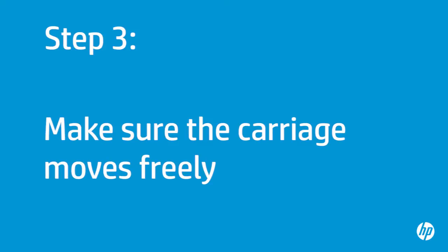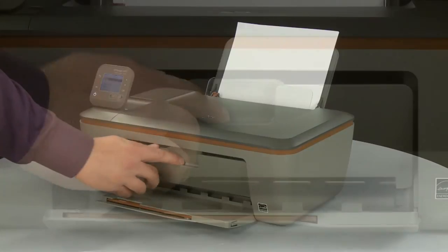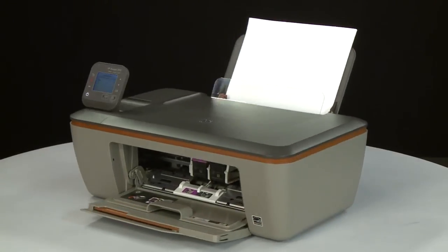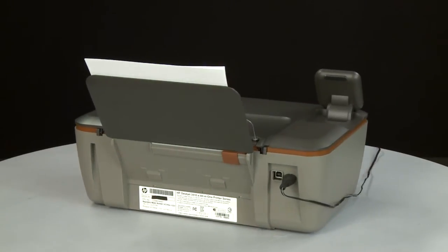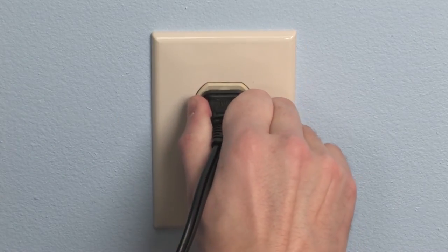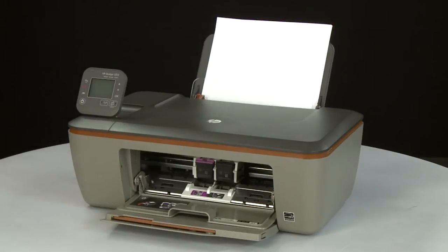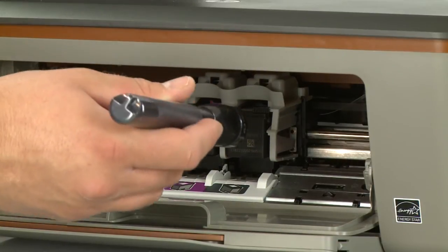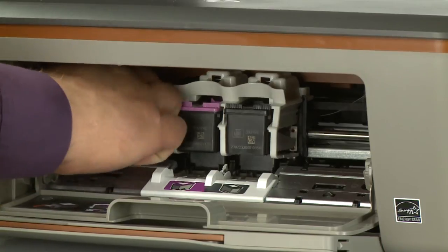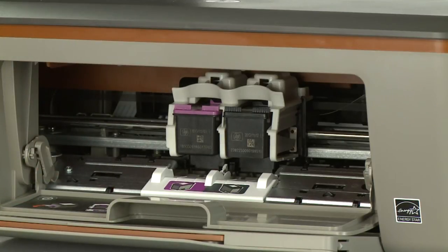Use the following step to make sure the carriage can move freely. The printer must be on for this step to work. Open the cartridge access door. The carriage might try to move into the access area — if it does, allow it to move to that position. Turn to the back and, while the printer is still on, disconnect the power cord from the printer and from its power source. Return to the front. Look inside the printer and check for obstructions around the carriage that could prevent it from moving. Use a flashlight to thoroughly search the area and remove any obstructions found. Check the rollers and wheels for any torn pieces of paper. If pieces of paper remain inside the printer, more jams are likely to occur.